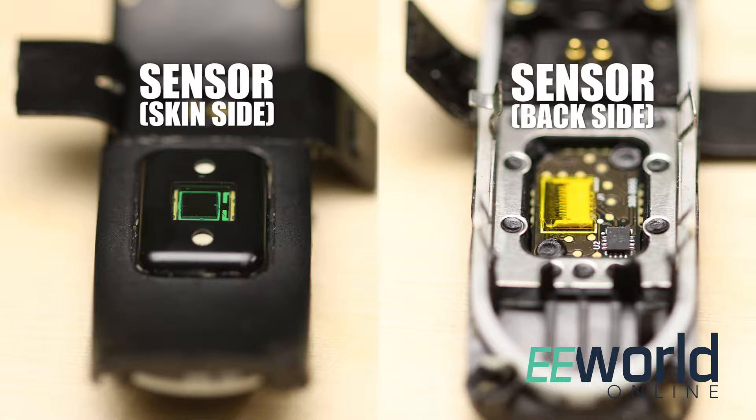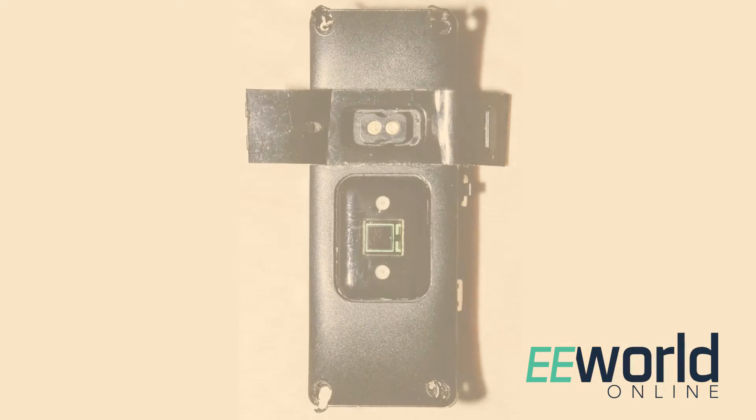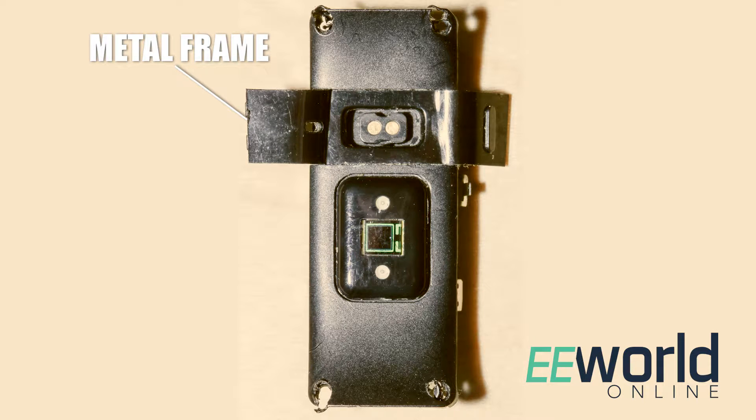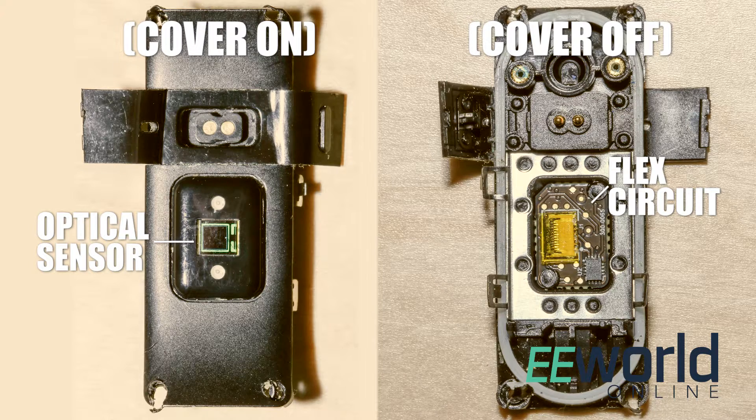No matter how good the connector to the main circuit board is, it's a potential source of noise that could be significant for the super low-level changes in reflectance you'd be dealing with when detecting heartbeats. What else can we point out about the part of the watch that holds the sensor substrate? The other interesting bits here are the connection for the recharging cable, which is reinforced with its own metal frame. And as we've said, the heart rate sensor connects to the rest of the circuitry through a flex circuit. What's interesting is that the connector to the flex circuit lies directly overtop the optical sensor — we might surmise the Fitbit designers really wanted to minimize the chance of those heart rate signals getting garbled, and that might be one of the reasons for situating the connector right where it is, as it might provide some shielding against other signals floating around on the main circuit board.